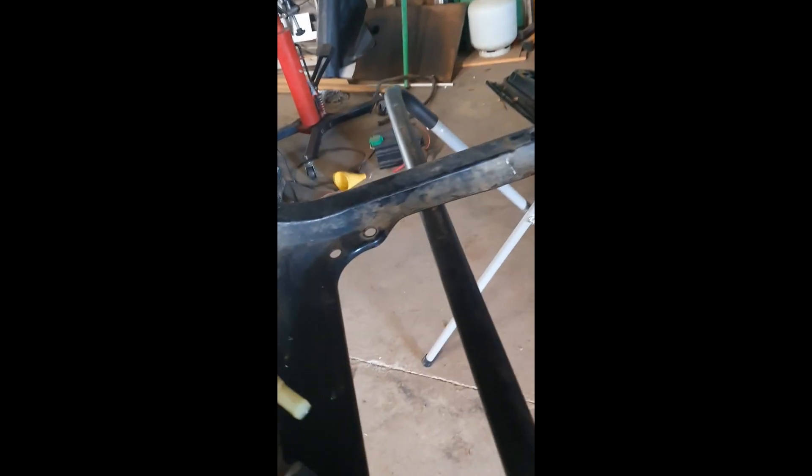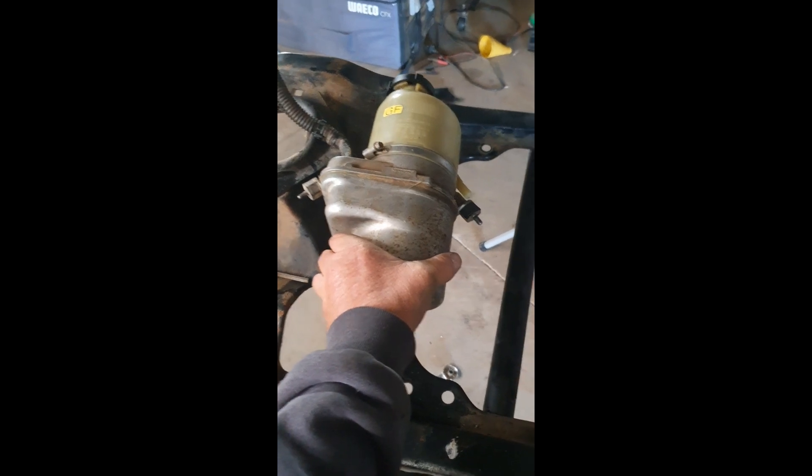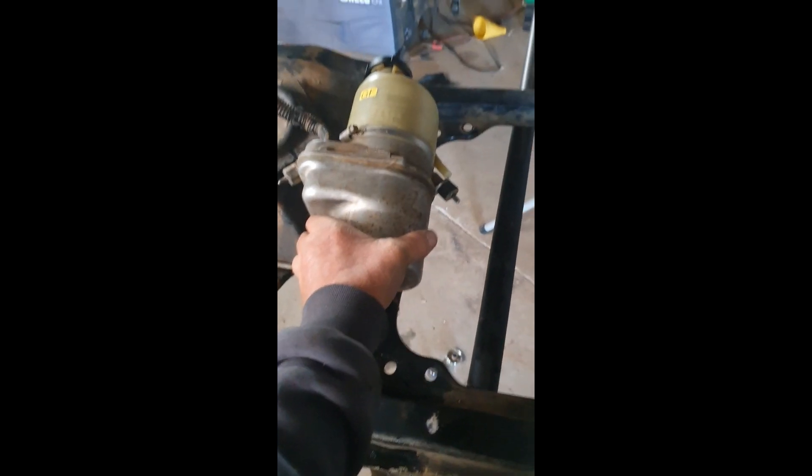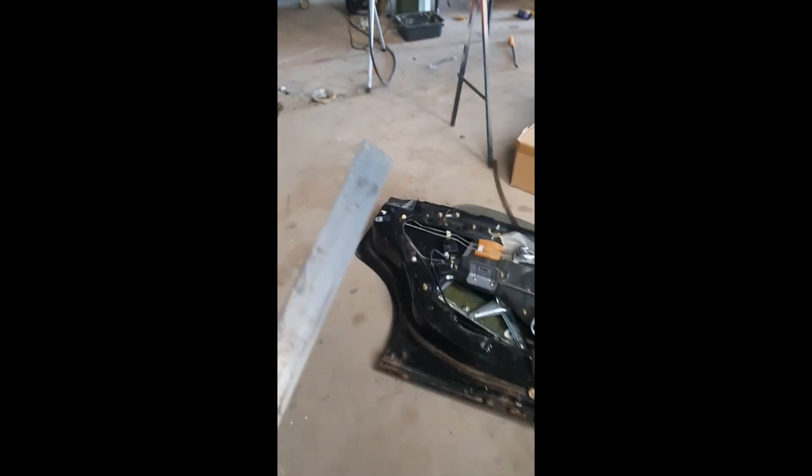I've mocked it up a couple of times and there is plenty of room between the radiator, the headlight, the nosecone and the grill. If it's painted black nobody will even see it in there, plus it's going to be a nice short run to wire up. So I'm starting with a bit of flat steel - I'm just going to make a basket for it, pretty much similar to the one it came out with in the Astra, but I didn't get that out of the car unfortunately. I'll just bend this up and start welding, see how we go.